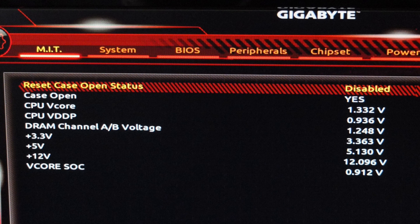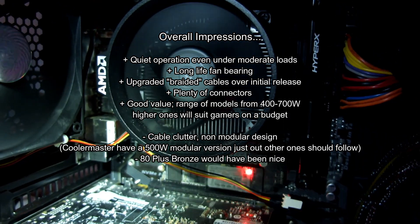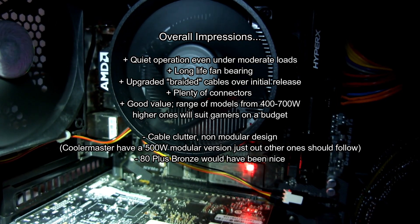As far as voltages go, keep an eye on that. On this brand new power supply you should see just over 3.3V, 5V, and 12V. On a failing power supply you'll see those voltages drop — that's if you can actually boot the PC. Hopefully that was of some use to you. I will update the review if I have any issues with this power supply, and thanks for watching.